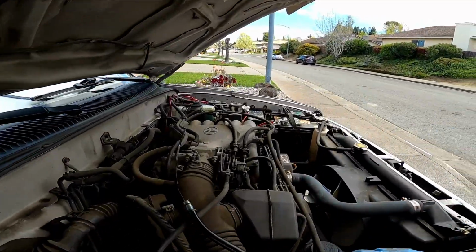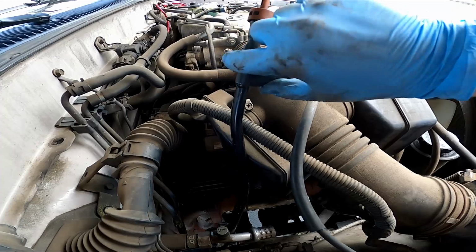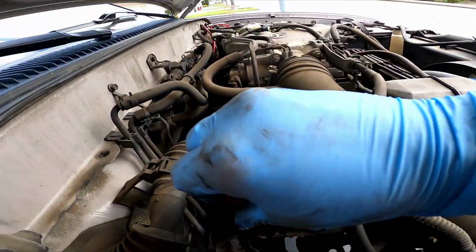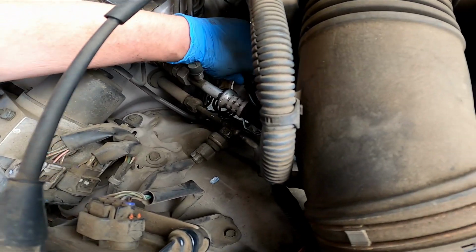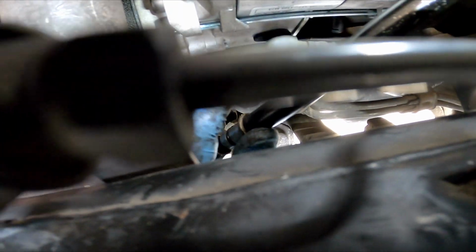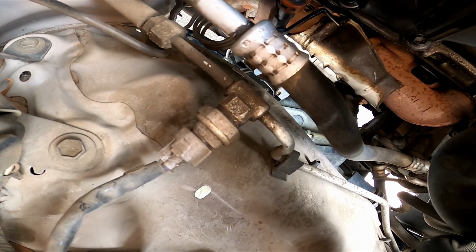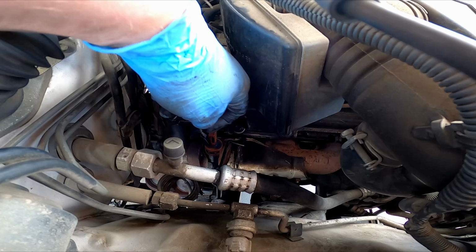And we'll feed this back in. Just plugs back in down there. All right, here's the joint, the dipstick tube. Push that in. It goes together. Make sure it's well seated. We've got our one bolt, which goes in here. 12 mil.